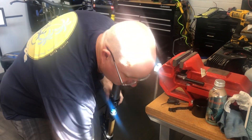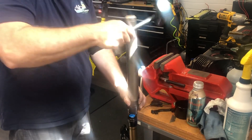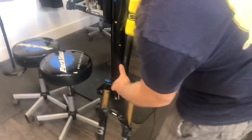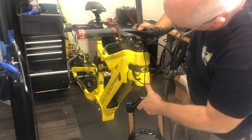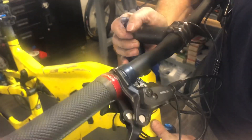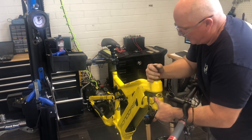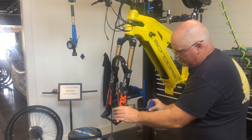This is some heavy duty shit — this isn't some wimpy-ass hammer and that's not some wimpy-ass pipe. You're smacking the shit out of it. He puts a bicycle seat post through the whole headset, then jams the fork from underneath. He tells me to pull the post out, and it held everything in place. I was learning shit. This is the whole reason why we're having a professional do this job — you can't build the best in someone's garage. In literally 15 minutes, Ray's got the fucking fork in the bike.